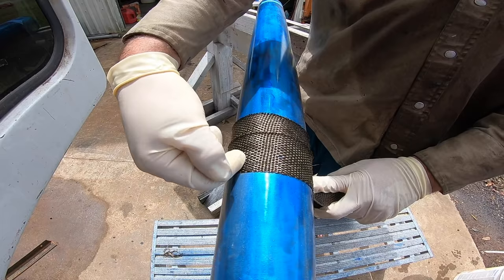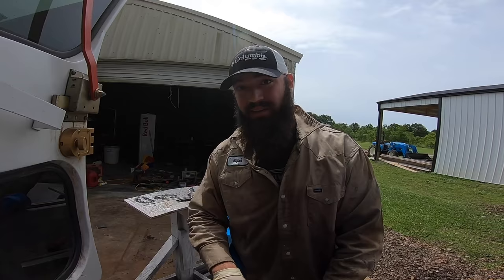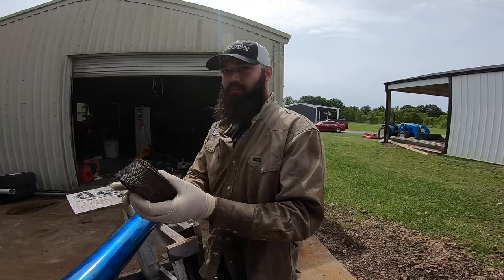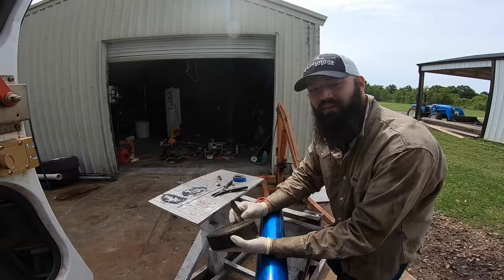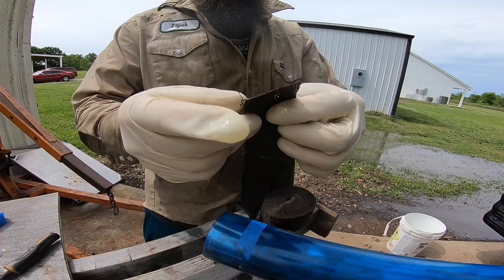I am going from the bottom up because it will make my laps run downward — just for rainwater and wind — we don't want it going upwards. If you're wrapping a bike or any other exhaust going sideways, this keeps the wind from fraying the ends. Make sure you wrap it in the forward direction. The way the stack is facing now is how it's going to face on the outside of the bus, so I want to make this side the pretty side and put all my folds and zip ties on the back side.